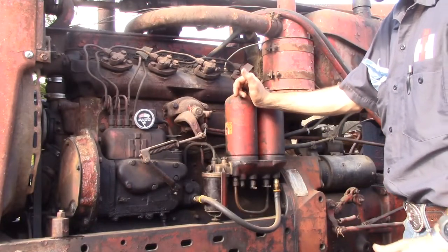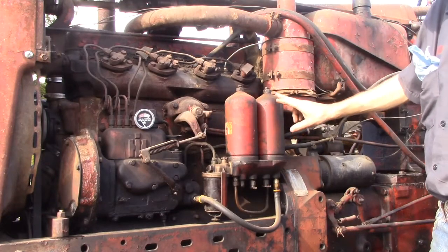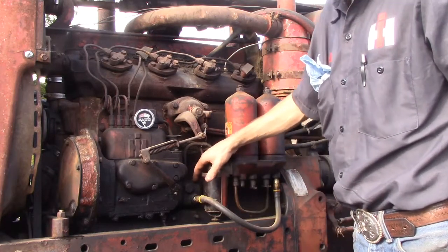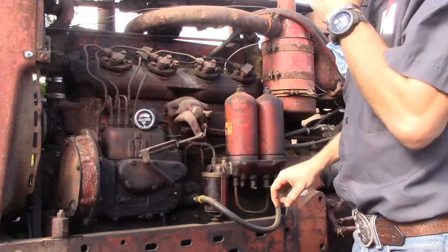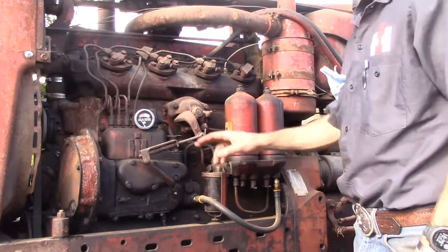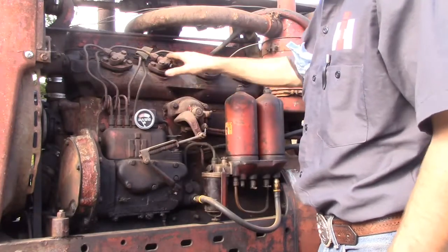Flow of fuel: on these it comes from your tank into your water fuel separator, out of your water fuel separator through the base to your auxiliary filter, which from the factory would have been a wound cotton yarn looking filter. After leaving the auxiliary filter it then comes out this line into your primary pump. This primary pump all it does is provide pressure through the last filter and provide pressurized fuel to your injection pump.